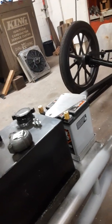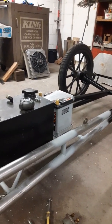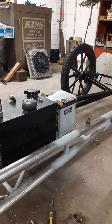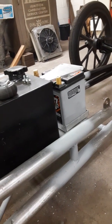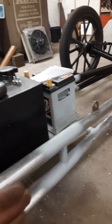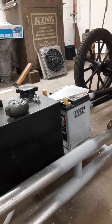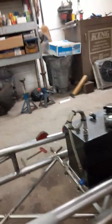So now that battery is a Braille brand body battery. Braille, not a sponsor, by the way, but you can mount them, you can lay them down, mount them sideways, diagonal, whatever you got to do. However, I don't do that. I believe it takes away from the life of the battery. Because when they assemble batteries, this is the top cover, your posts are on top, and they put the plates up and down, and in my opinion, they last longer when you mount them upright. When you lay them sideways, the plates are now being mounted sideways, and I just think that shortens the battery life. At least that's been my experience, but then again, it's opinion, so take that as you will.